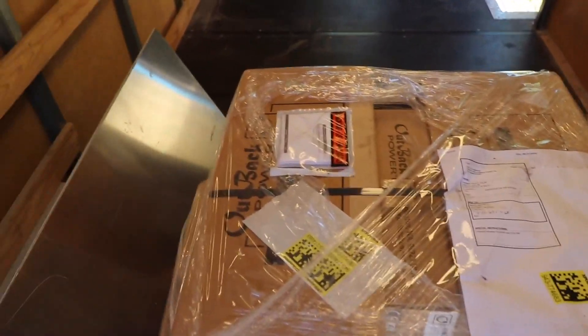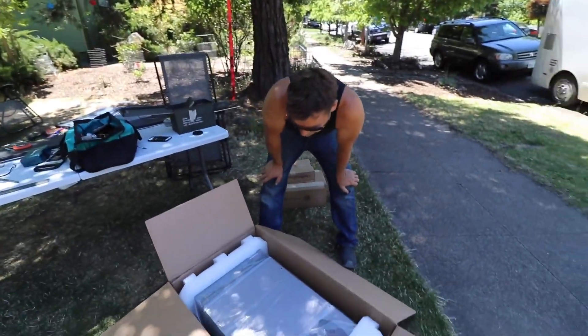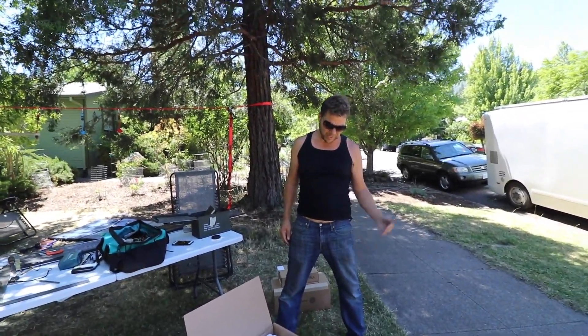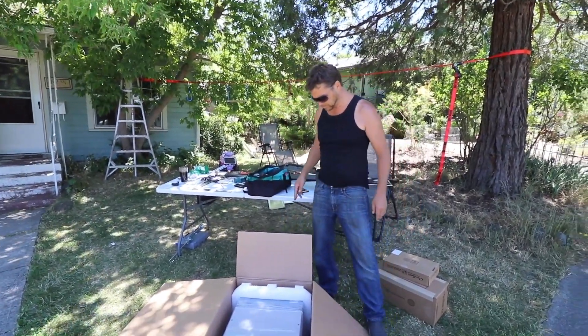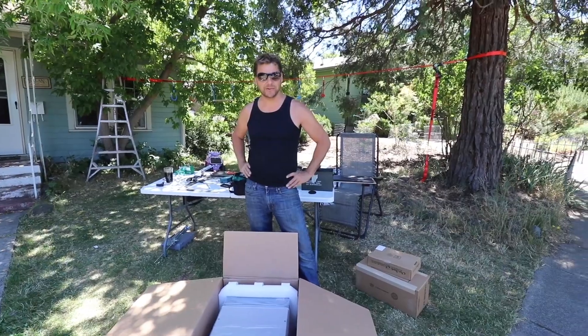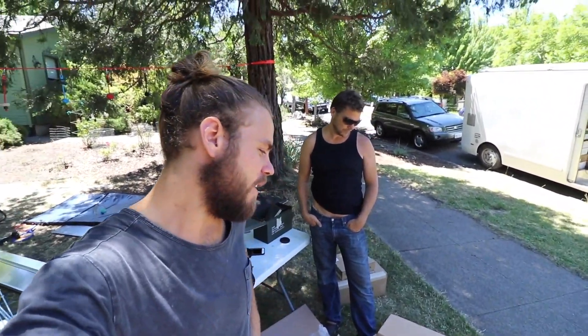We just got back and right now we have to open these packages. We're opening up our inverter — Brett is. This is an 8 kilowatt Outback Radian, so this will take our 48-volt secondary battery pack, step it up from 48 to 220, and basically charge the van. We're using an inverter that's usually applied in a household situation because we can still get ground, and that was the biggest issue — grounding it. A vehicle is a floating ground situation, so we'll do chassis grounds throughout the vehicle. This inverter is going to be the brain — or the heart — of the vehicle.